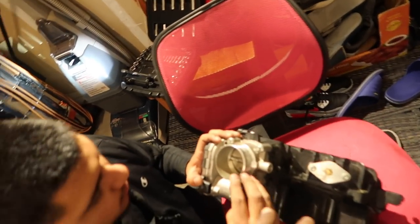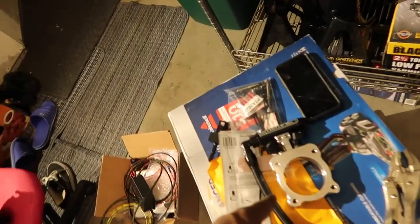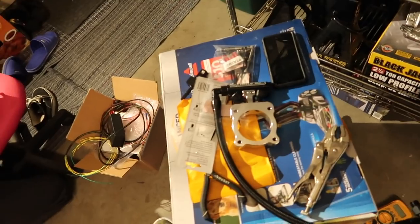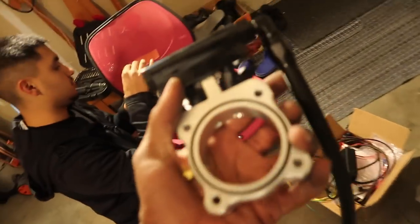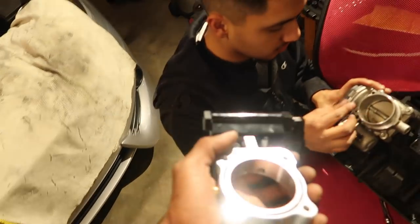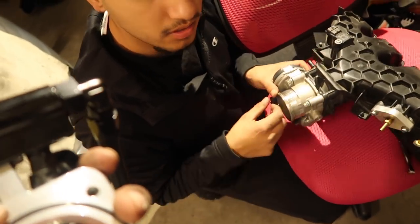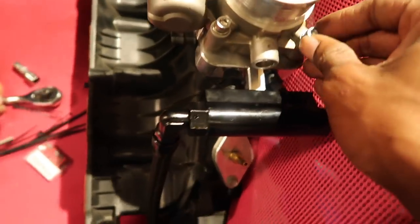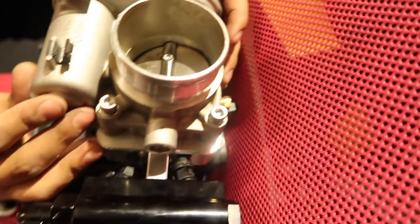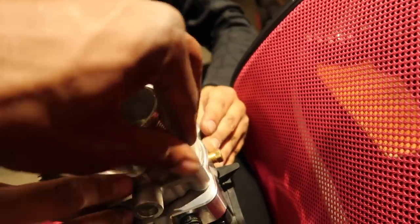So now, since we have the intake manifold off, we're taking off the throttle body and installing the aux fuel spacer. The O-ring should already be on there. We're figuring out how to face it — it's easier if it's still in the car, but it's not. We just have to figure out the orientation. The injector port goes off to the side. Nice, got it.